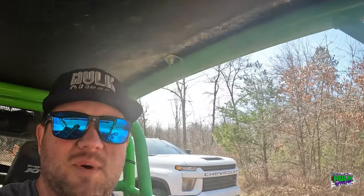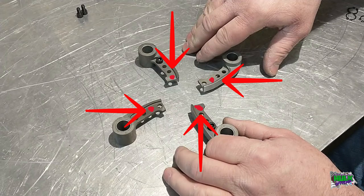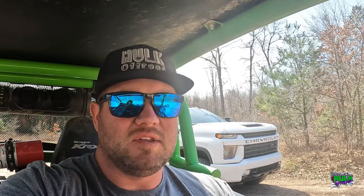I have this set up two bolts in the very toe and then two in the one before that. My RPMs are a little higher than I'd like because I do some road riding, some fast riding, ripping trails and stuff. So moving the primary spring is gonna lower them RPMs down so it's a little more comfortable when I'm ripping the road.